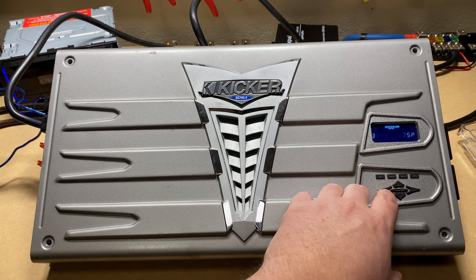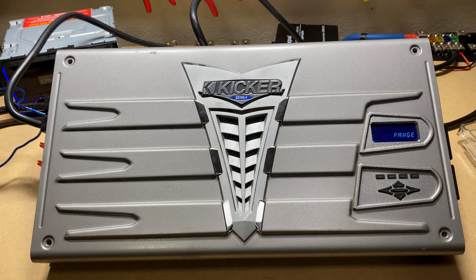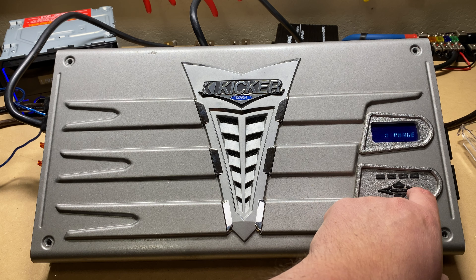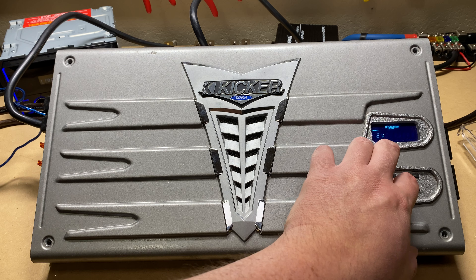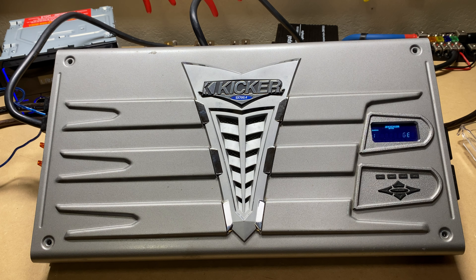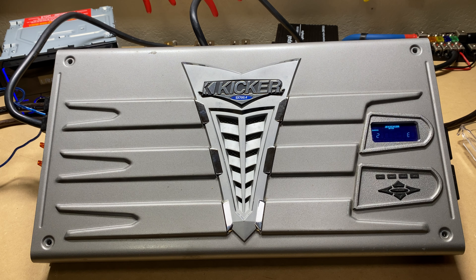You can bypass the DSP and you can select your gain range. This one took me a minute to figure out. You've got a gain setting in the main portion, but the gain range - if you've got one of these amps you can start at 1 volt, 2 volts, 4 volts, 8 volts, or 16 volts in. So if you are not getting the gain that you need, this setting may be too high. If you're having to really crank your gain up, you may have this on 16 volts or even 8 volts. With a normal head unit you're getting 2 volts; a nice head unit you're getting 4. So it's nice to have this - make sure you check this before you set your amp.